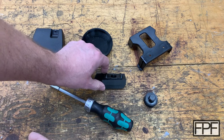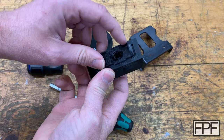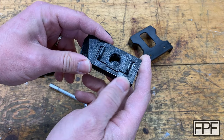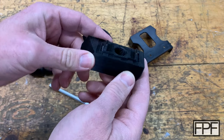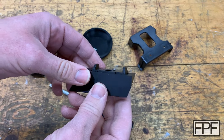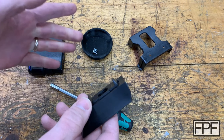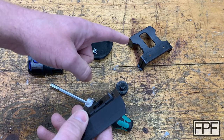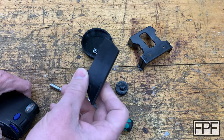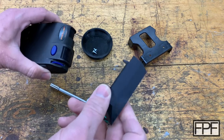Here we are back at the workbench and this is the piece I designed, along with this threaded knurled piece. The way this works is this shape here keys into that steel bracket that holds the onboard diagnostics plug. You can see from the texture in the print there are quite a few angles on this piece that get the bracket pointing exactly in the direction we want. I went through more than a dozen iterations until I was satisfied with the angle and position for this brake controller. The good news is this style of mounting bracket is fairly common for brake controllers, so this should work for a number of other controllers as well, though it is specifically sized for the Primus IQ.